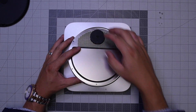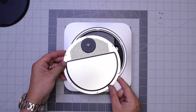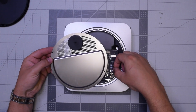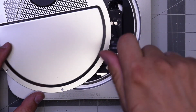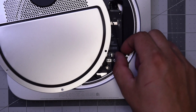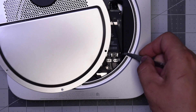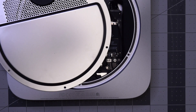With those six removed, go ahead and start pulling up on the Wi-Fi antenna. Be careful — it's still attached to the Wi-Fi and Bluetooth card. Use the T6 screwdriver to remove that screw, then gently with tweezers pop out the antenna and disconnect it. Now we can move this out of the way.